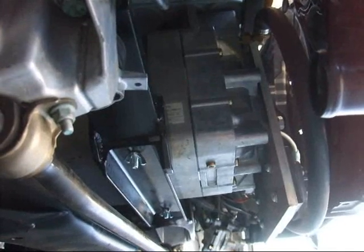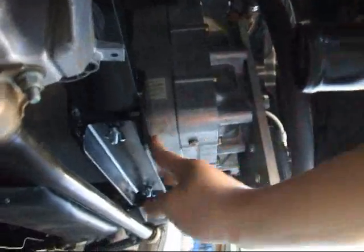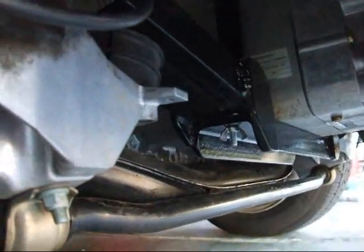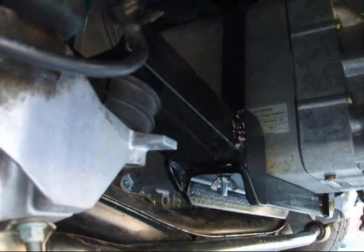Here's the picture underneath the car — that's the Siemens motor, and this is my motor mount bar right there that I built. I replaced the liquid-filled motor mounts with solid rubber mounts because the old ones are failing.